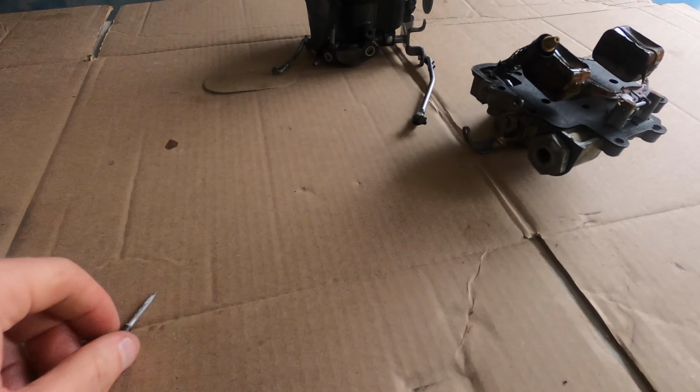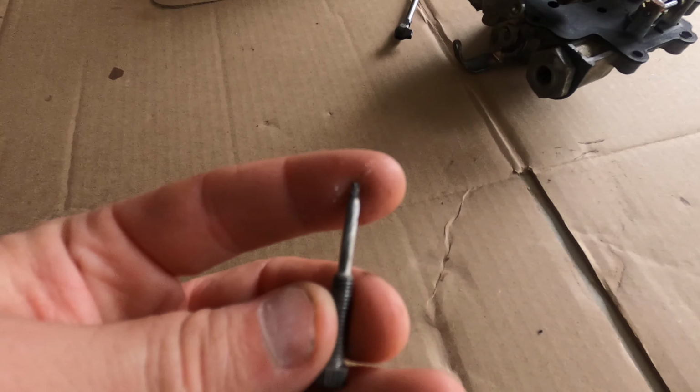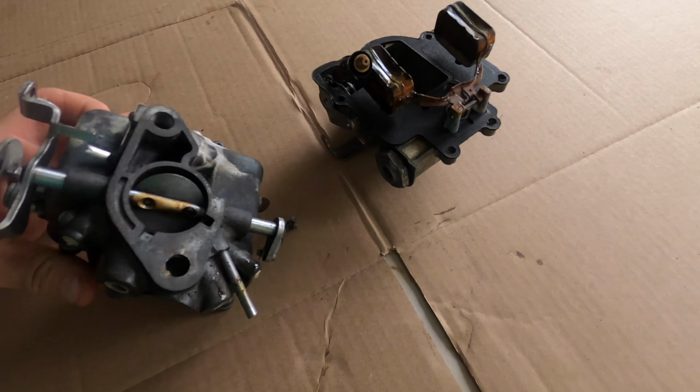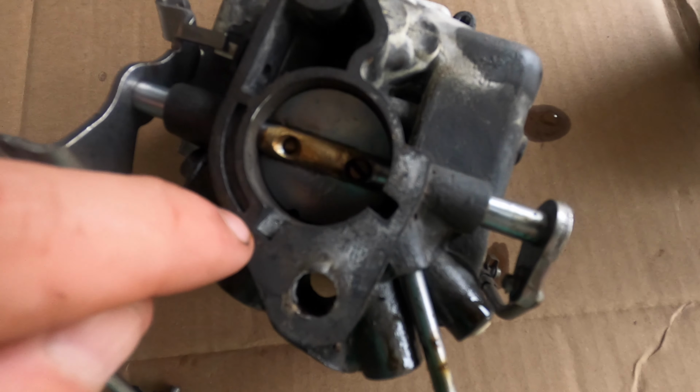So it's about a week later, and the parts for the carburetor that I'd ordered from Clark's Corvair finally came in. Super excited to pop them in so we can see if this car runs. I went to make sure all the needle settings were right and everything was perfect, so that when we fired it up, it was going to work. And I noticed something about the idle air needle. It just didn't feel quite right, and so I took it apart, and what I found was the tip of it was broken off, which meant, unfortunately, it is down in there.